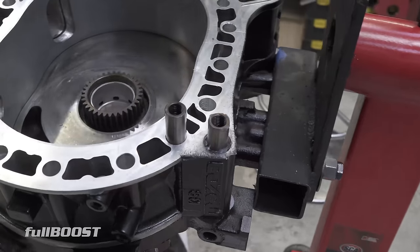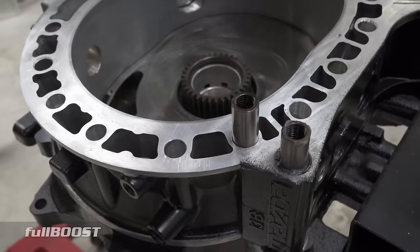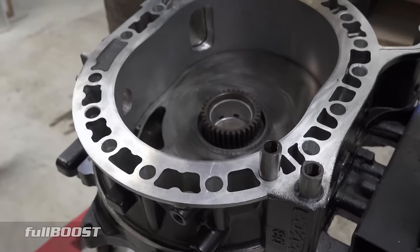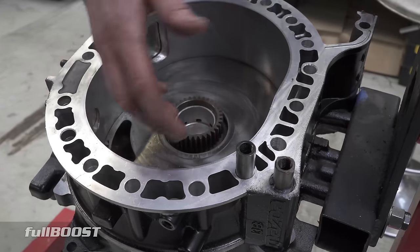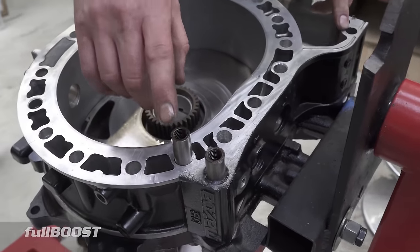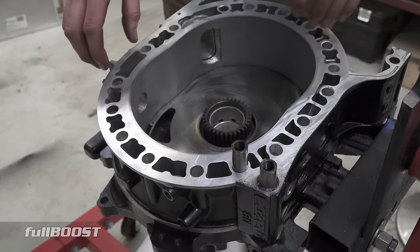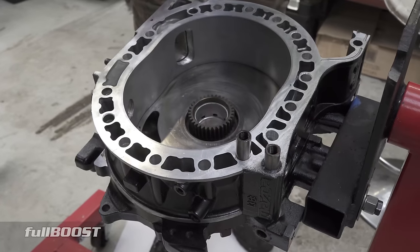This one had to be drilled out to 16mm to suit the dowel, and all the other ones were drilled out to half inch. This was already drilled out to a dowel recessed in the centre plate, so the factory through bolt wouldn't be long enough. This actually uses a super long bolt called an M-bolt — because there's an M Mazda logo stamped on it. Because the plate had been recessed, the new PowerSeal half-inch stud kit won't sit in that hole properly. So if you've got a dowelled engine and you're looking to run bigger half-inch studs, you probably won't be able to run them if you're using these dowels.